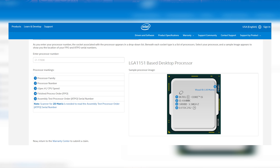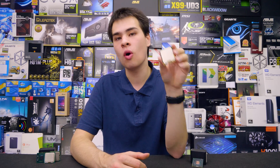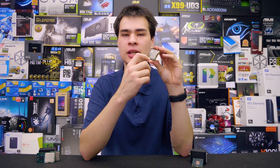The first and most obvious way to spot a fake is by looking at a legit version. If you're shopping online, get the biggest, highest resolution image of what you're looking at, then go to Google or a legitimate PC review site and find a review image of the CPU where you can see all the coding and contact information. After looks, check more specific information beyond just the model number. Look at the FPO, ATPO, CPU family, processor number, and in some cases the specified manufacturer location. Take that information off the CPU and match it to the actual box. A fake CPU can't line up the coding on the CPU, the PCB, and the box all at the same time — a lot of knockoff manufacturers just throw it in a legitimate box and everything doesn't match up.